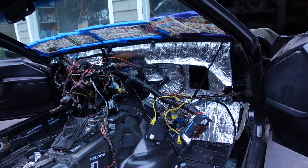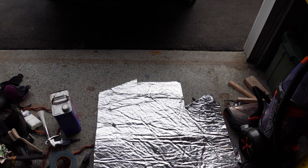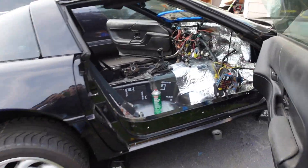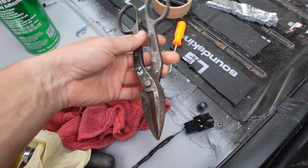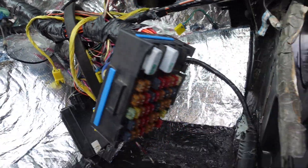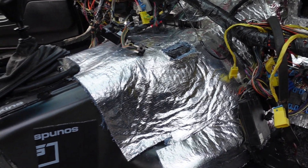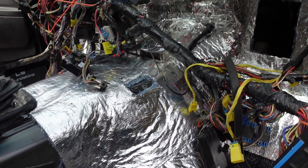We're coming along and it's looking really nice. I got a lot of areas down — I also covered up a lot of our repairs here. Under the gas pedal I'm leaving an area for the column to mount, but I did get it to go all the way up on the side and on top. I'm trying to cover as much firewall surface area as I can feasibly get to. I got the floor in the front area and anywhere firewall-related where there's going to be heat I have wrapped, and the trans tunnel where the transmission is going to make noise. That's where the factory wrap was, so we're just going to mimic that up here and on the trans tunnel.